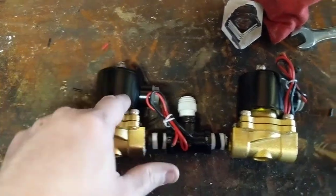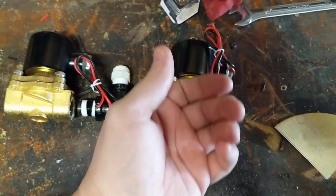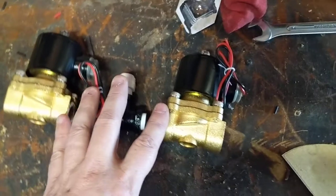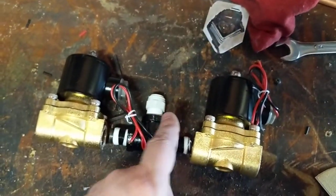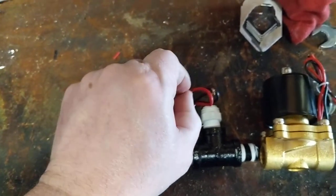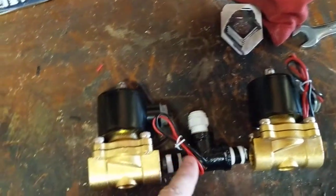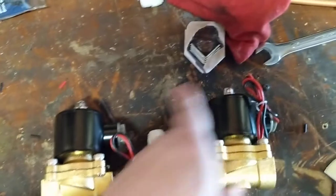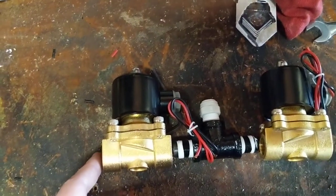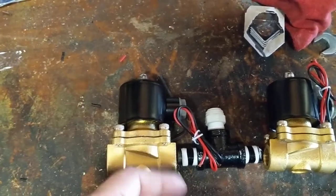Here's your other solenoid — in and out, my arrow right here. You want to hook it up like this. If you're worried about which way it's facing, you can loosen up this nut and move it around. So let's say this is the left side — here's my airline to my tank. You want to hook this red wire up to your control, which is left up, and then black is ground. You can hook up both black wires and hook them up to ground.